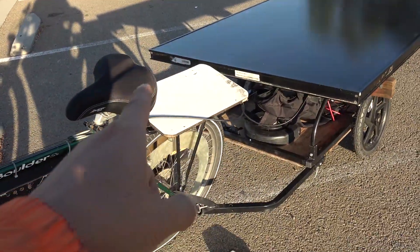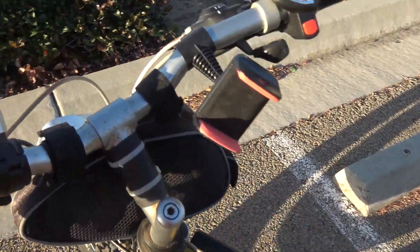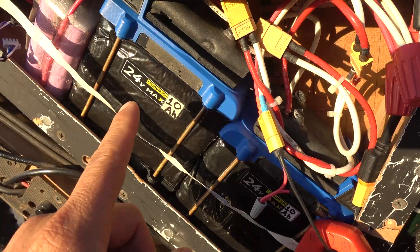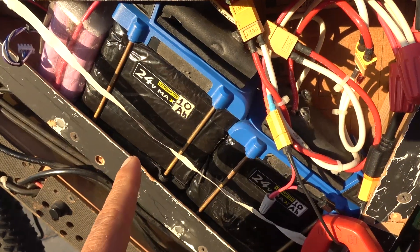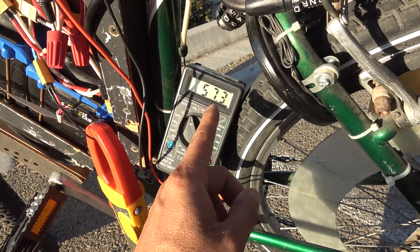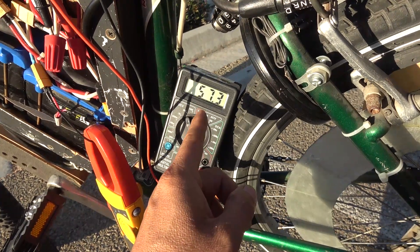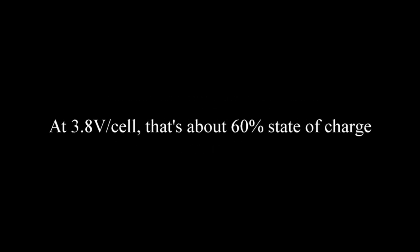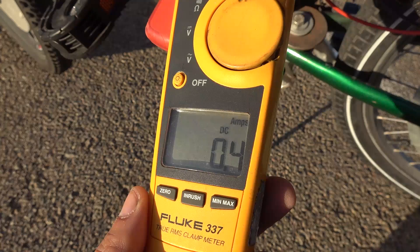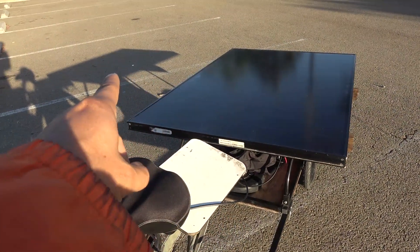See how long the shadow is right now. I've reached the end of my trip and I have traveled over 26 miles — more than twice the range of my battery pack, which only gets about 11 miles. Battery voltage is 57.3 volts, that's about 3.8 volts per cell. We're still charging at 0.4 amps because the sun is going down, with the shadow quite long.